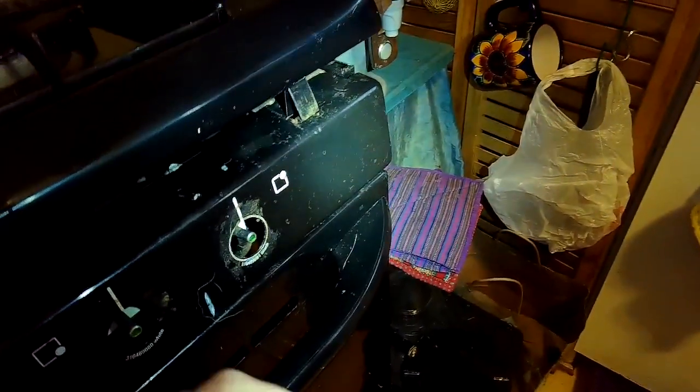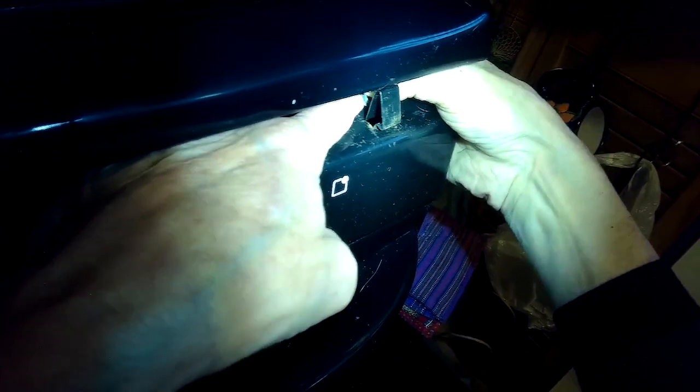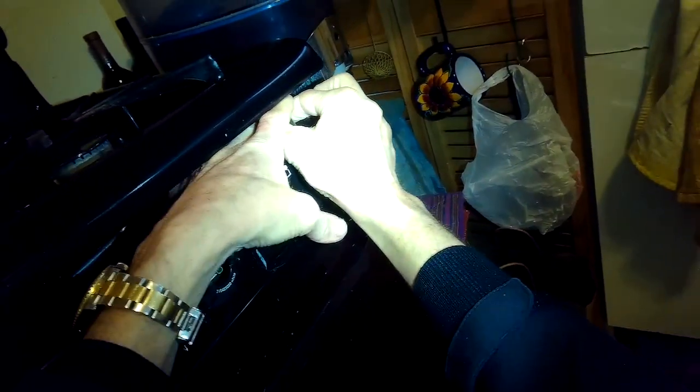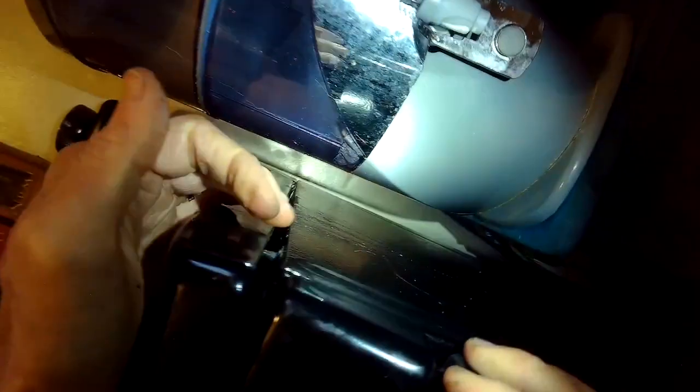Feed in that screw finger tight then tighten it with the wrench. The little screws that hold on the burner heads are very small, and if it's a brand new stove it's easy to pull those off because they're not corroded. But after even a year's time you get grease and rust in there, and if you give that screw even a little turn it'll often snap — then you have to drill it out, which is a real pain. So this way works; you just have to be careful not to bend those gas tubes too much. Now I'm going to push the top panel back down — there are a couple of pins that help index it on the right and left-hand side — and push it down until the spring clip locks it into position.